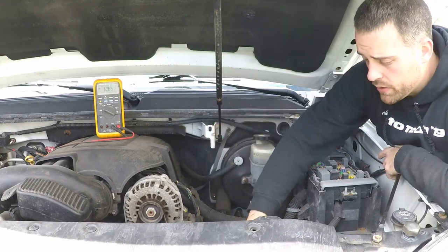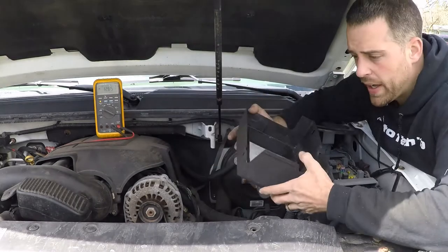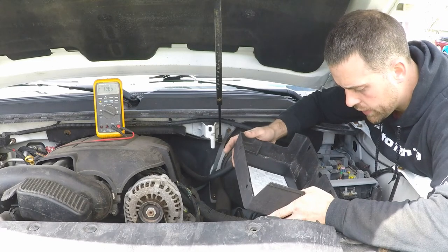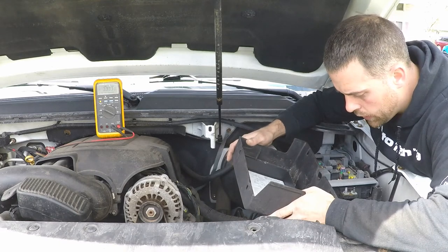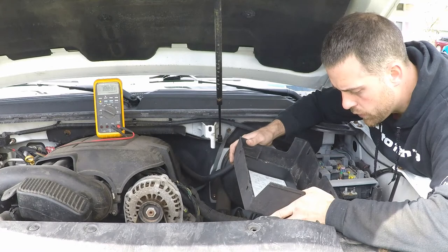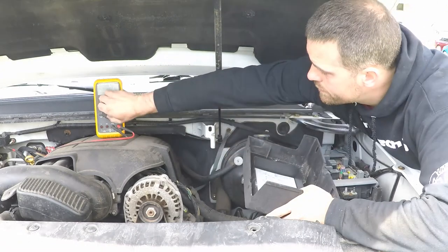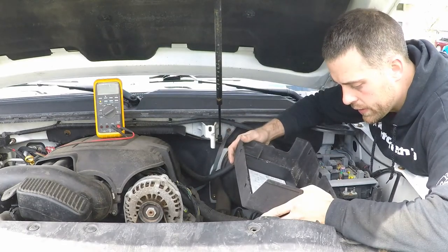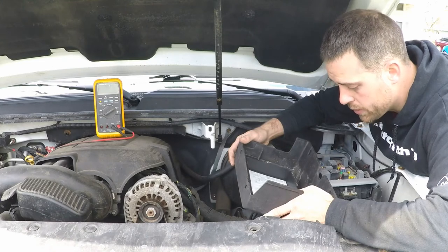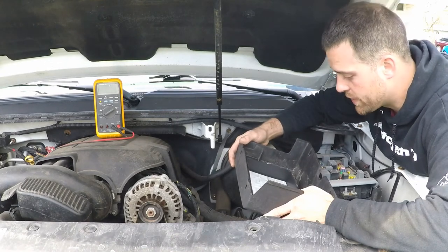But let's talk about what we actually did. We applied a ton of amperage to our vehicle, and if we go by this chart here as an indicator of what we put against this thing, I had the cooling fans on, so let's see what the cooling fans are rated at. AC compressor was 10 amps, so it's 8. Let's see, the ECM, engine, throttle control, those are both worth 15 amps apiece. And my battery is dying on my meter. So my current load with those two is approximately 24 amps. If I talk about my heated seats and the heated mirror system, there's another 15 each. So another 24, that's 48 plus the extra 8, so we're at 56.